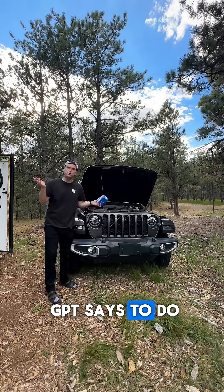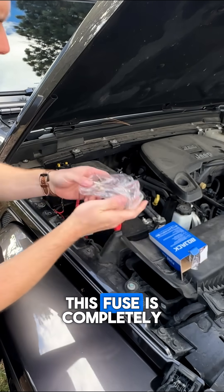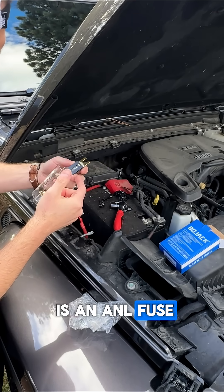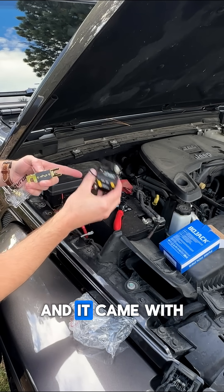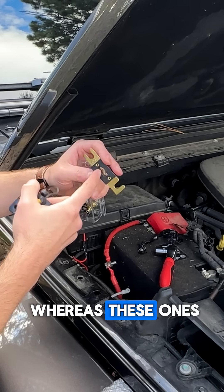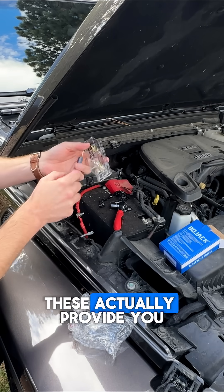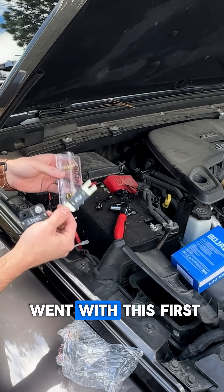That's what ChatGPT says to do. Opening up the Jeep right away, you can see that this fuse is completely different than this one. That's because this is an ANL fuse, and this is a circuit breaker. I first installed the circuit breaker because I bought my DC-DC charger and it came with it. I do like it because while it can trip, you can reset it and keep using it. Whereas these ANL fuses — once they trip, you've got to replace the blade completely. But from what I heard online, these actually provide better protection than the circuit breakers, and they're a bit cheaper, so that's why we went with this.